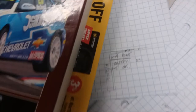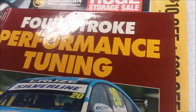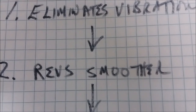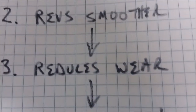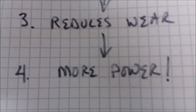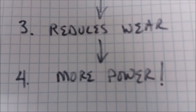To summarize what's covered in these technical videos and resources like Graham Bell's 'Four Stroke Performance Tuning': why balance an engine? It eliminates vibration, which can literally shake the engine, and it enables smoother and faster revving — you can hit higher RPMs. It reduces wear on the bearings and other engine parts, and actually results in more power. You can dyno check a well-balanced engine versus an unbalanced one and see the difference in power output.